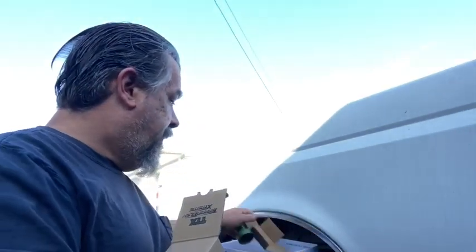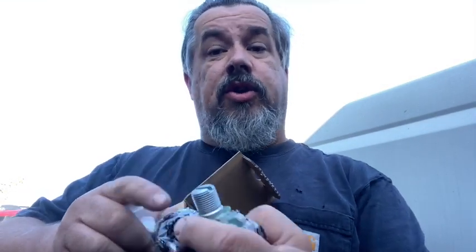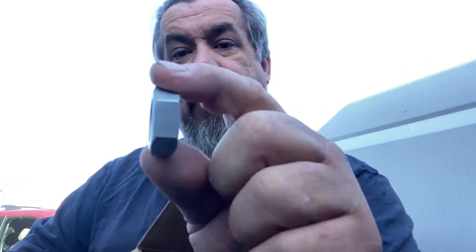Packaged pretty well. So what these guys do, which is very smart in my opinion, and it's because I said the nut being crushed the way it is a major problem because you can never get it all the way tight. And then the stem of the ball joint right here starts to spin and you can never get it tight. Well, these guys put this in here so you can hold it if you need to. But the nut has a Loctite on the nut and the nut is not crushed. I've never had one of these spin the shaft when I'm putting them together, never. But even if it does, at least you got a way to hold it.